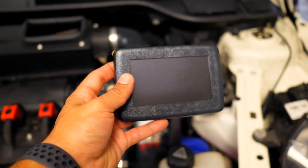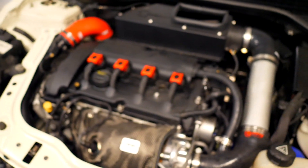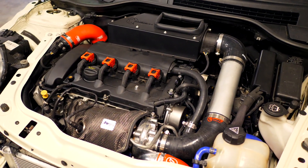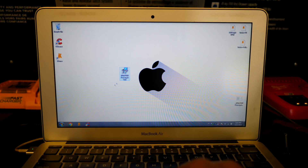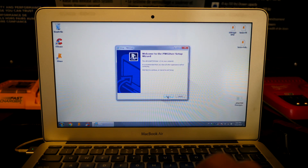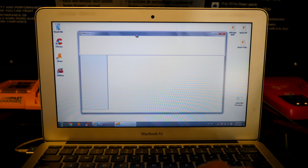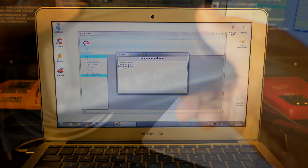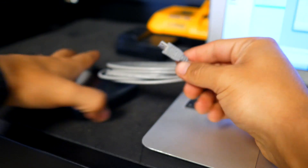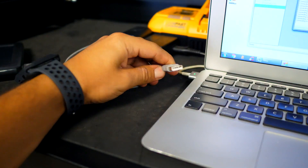If you don't want your car out of commission for a couple of days, you can purchase this PowerGate option — and this is what I'm going to show you how to set up. Once set up, they'll be able to remotely tune your car as many times as you'd like, so if you change your intercooler, turbo, or any internals, they can accommodate that without you sending your ECU out every time. With the software loaded on the computer, we'll install it — install, yes, next, PowerGate, yes — and it automatically opens, loading up and looking for the device. Grab the PowerGate module and the USB cable, which goes into the top of the controller.